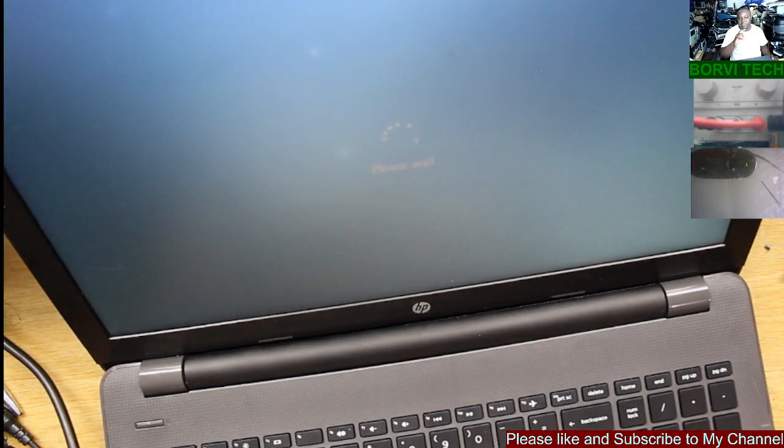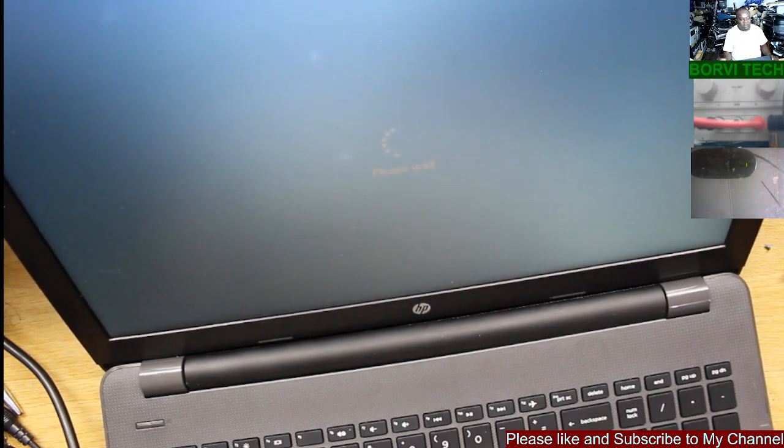Please make note of those parts. You copy the DMI of the backup to the extracted ones which you got from the official website, otherwise it won't recognize the serial number. You take that information, then you put it on this other side, then you'll be good to go.